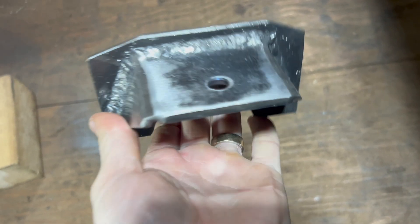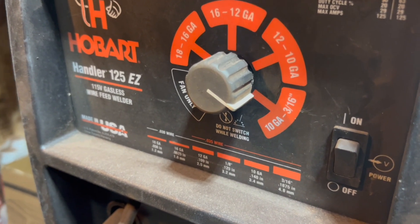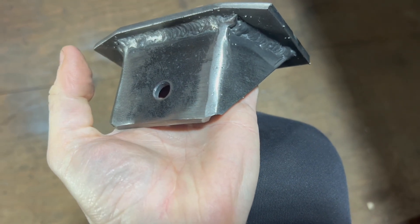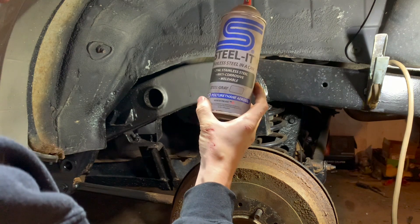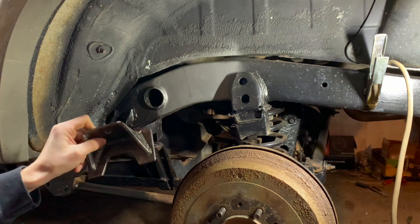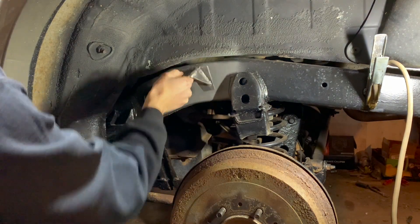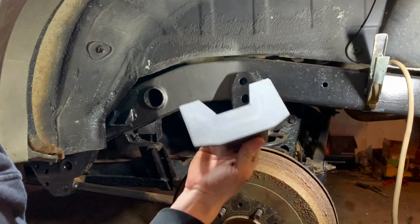I've got my first side made up. Honestly I'm not mad about how the welds turned out — I'm not a good welder by any means. It's a Hobart Handler 125 flux core welder and I think these welds are just fine. Some I grinded down because they kind of suck, but the rest passed my visual test. I've also got both sides coated with weld-through primer — it's super expensive but worth every penny. This one is apparently the best for making it feel like you're welding on bare steel, and when you're sandwiching two pieces of metal it's good to coat both sides so you don't have rust problems down the road.